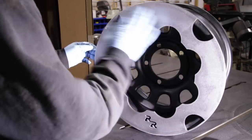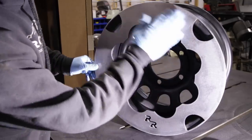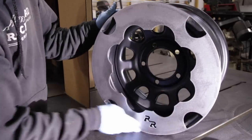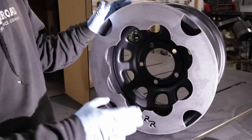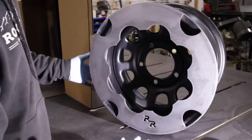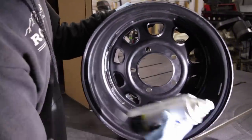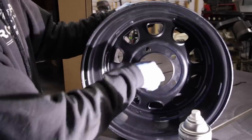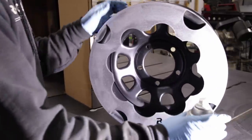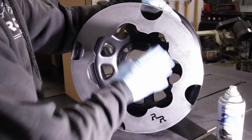After spending a few minutes DA'ing on the wheel, you end up with this. I used 40-grit DA pads and it worked pretty good — I got most of the sander marks out and it is pretty flat. I have the other four rock rings welded, sanded, and painted over by the Jeep drying. On these I was starting with paint on the backside, making sure I really coat the back of the ring and all the cracks where water might sit. Then flip it around and blast the front. I wiped these down with denatured alcohol after the DA process to get rid of any oils.